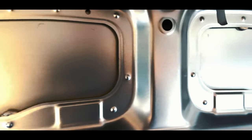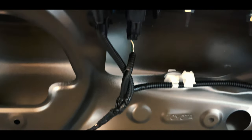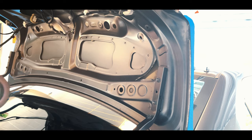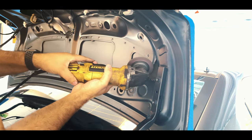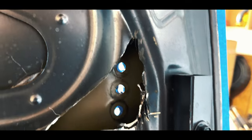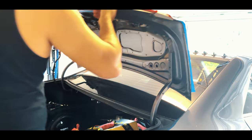Let's open up our trunk and see where the holes have been placed through. Unfortunately our holes are underneath the subframe of the trunk, which is welded on, so we can't easily remove it — we're going to have to cut through it. It's best to bolt the rear spoiler to the trunk and not to the subframe, because over time bolting to the subframe will cause it to crush into place and become loose. The tool I ended up using was a grinder to gain access to the holes. Make sure you grind down both sides evenly.